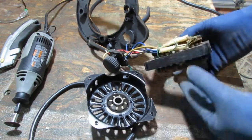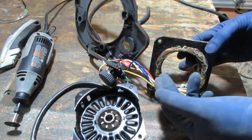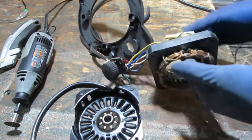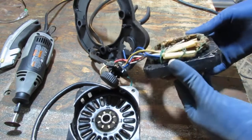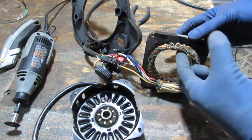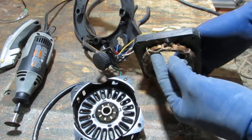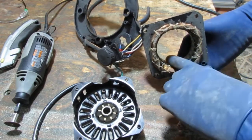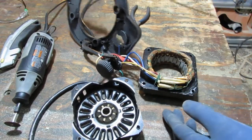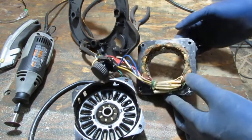So what I did — I took this apart, I cleaned it, fixed it. I checked the windings — they looked okay. I checked for continuity, because it has two sets of windings. That was fine. I cleaned out the inside here — it was kind of thick with grease. Looked like it was in a restaurant, a Chinese restaurant, because I found it outside on the street. So if all else fails, we're at least going to get this wire off of here and get this switch off. Let's see if we can use it for something else.